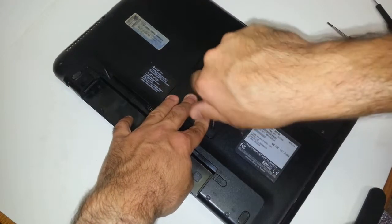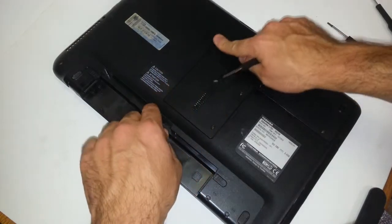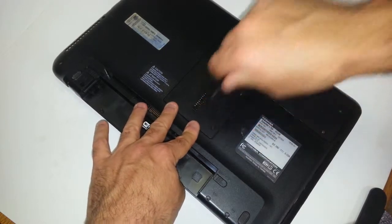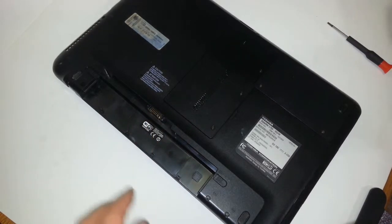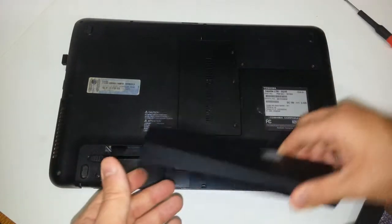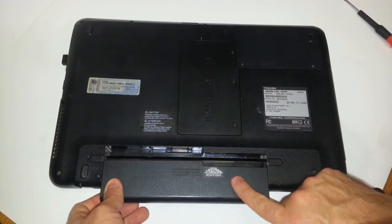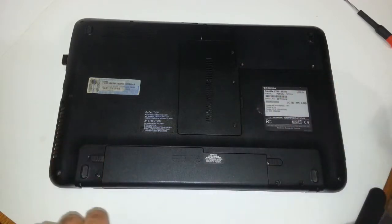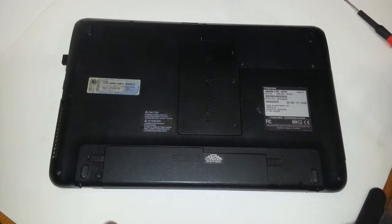There are only three screws. You want to make sure this piece has snapped in evenly from all corners, and make sure these are tight — hand snug again is just fine. Now you're ready to install your battery back on. You want to start evenly from the back, and the battery is basically going to snap back in going towards the front of the laptop, which will lock it back in place. Put the locking tab in the locking position, and you are good to go.